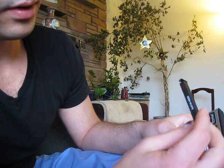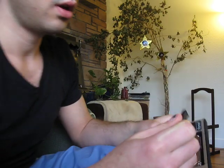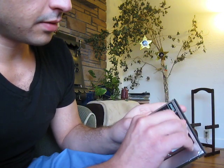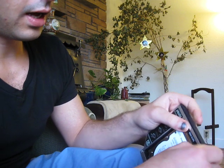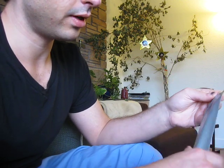Now this came with this thing called the adapter retaining latch. This doesn't work very good. It's possible that this is just an extraordinarily cheap drive caddy, but it's supposed to go down, and the part with the lip is supposed to sit over the top of the drive, and this is supposed to snap in. And that's how the drive gets held in. You gotta kinda force these latches out to hold it in, stuff like that. In general, it's a situation that I would rather just employ something that I know works, absolutely.